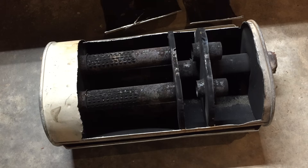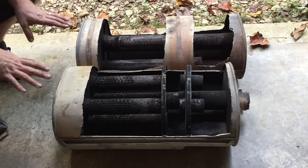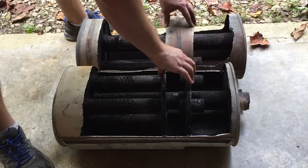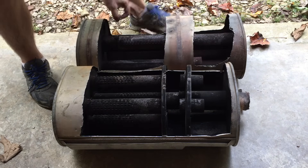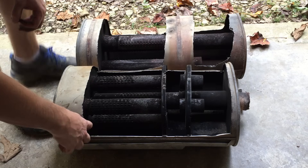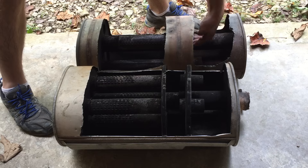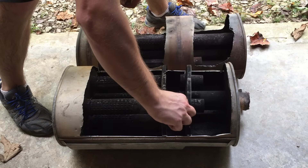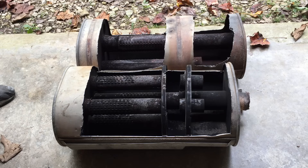It's definitely a lot smaller than the Silverado. Let me grab the Silverado's muffler and we'll set them side by side and compare. Sitting side by side — this is the Silverado muffler, and this is the Yukon muffler. The exhaust goes into a small chamber, just like the other one, into a bigger chamber, and it reverse flows to a small chamber and exits. Very similar in design. There's one big hole in the Silverado's chamber, whereas the Yukon has four less-than-dime-sized holes in this panel instead. This lower pipe is inside the small chamber on the Yukon, whereas the Silverado's lower pipe is in the bigger chamber. Similar in design, but enough differences to be really interesting. Both do a fantastic job — stock mufflers do a great job of reducing exhaust noise. There's a whole lot of science going on right here. Science rules.